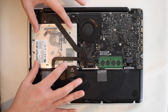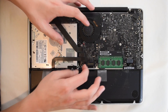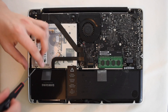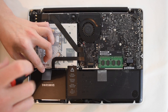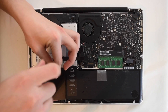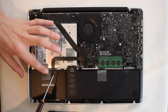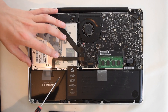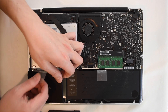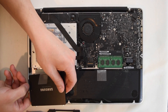This is the optical drive, and this is what we'll be replacing today. The first step into removing the optical drive is to unplug these two cables. Then we're going to remove these two screws in the bracket between the optical drive and the hard drive. Once that is removed, you'll see there are two more screws holding the optical drive in place, so first we're going to remove our hard drive and gently disconnect it from the SATA cable.